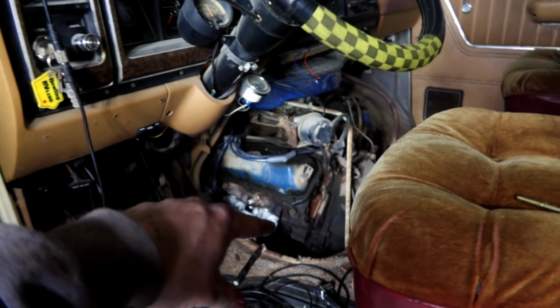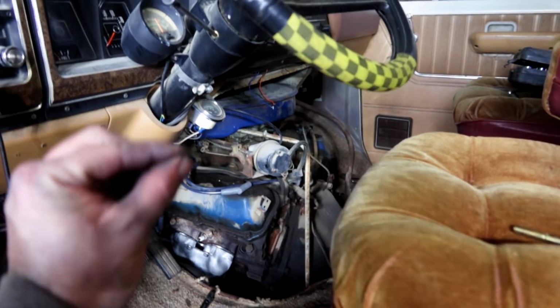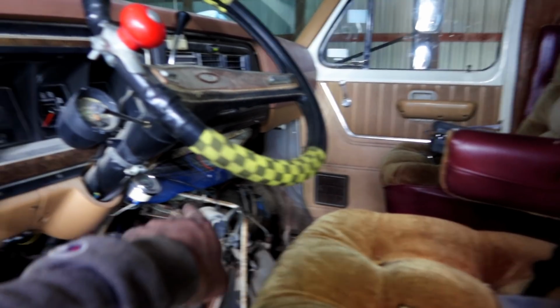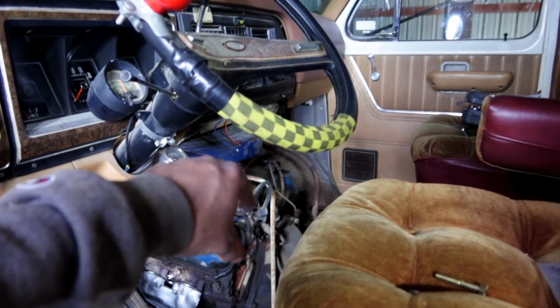These next two you're just not going to be able to see, so I'm just going to go for it. This side and the one on the other corner are the ones that are missing on the ends. And those are the only two that they don't make one of those exhaust clamps for. Stupid. So I can only get them for that side and this side, but I don't even need them on either one. That side actually could use one. I just have to get some hardware, a longer bolt, so that I can press it up against there.